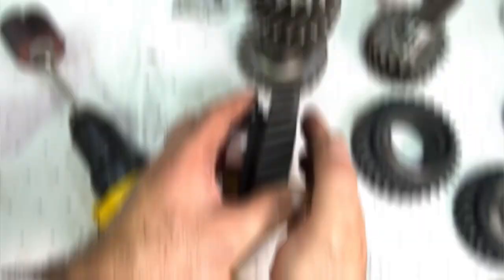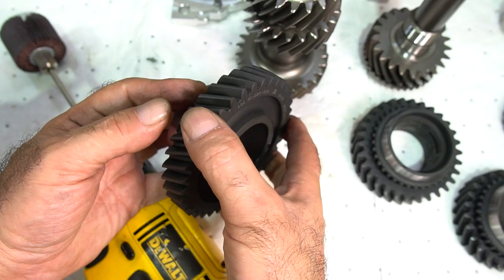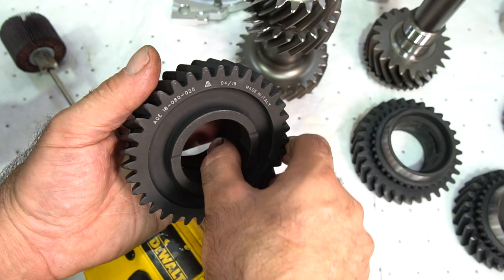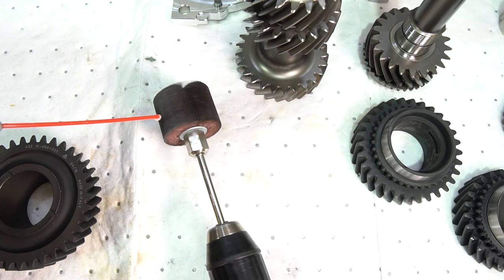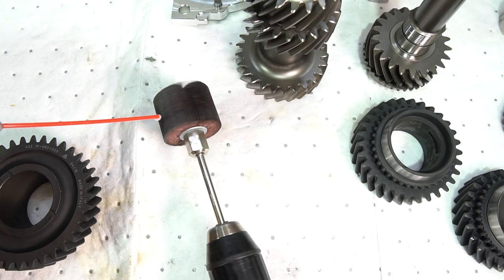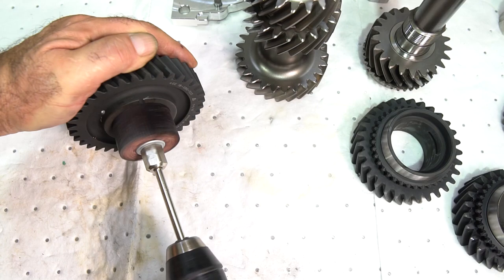With this particular Muncie build I'm going to be using new gears, and the biggest problem with a lot of these new gears is that they overdo it on the phosphate coatings. There's too much coating and it gives a very rough, drag-like finish to the gear, which doesn't allow the gear to spin smoothly on the shaft. I get different bore polishes, and I'll spray some WD-40 as a lubricant on the polishing tool, put it in here, and go through the bore just to clean it up — I want to take that coating right off so it spins nice and smooth on the main shaft.